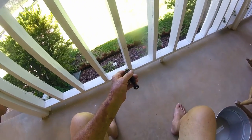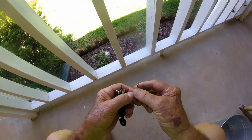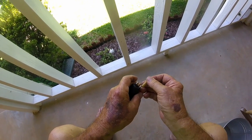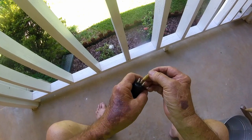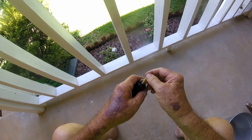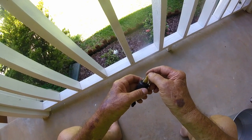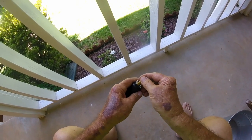So I kept pulling wires off and checking them. See this connector right here — this is the purple wire that went to the center post. It just doesn't snap on. I noticed all the other prongs would just snap right on there. I even took and trimmed off some of this rubber to see if I could get it connected. I decided I'd probably damaged it, but it could have been a problem with that wire all along. I'm pretty sure it was a bad ignition switch. I hate to think I bought one and didn't need it. Anyway, what am I gonna do? That wire ain't making connections.